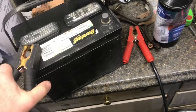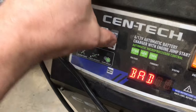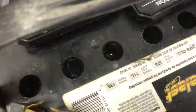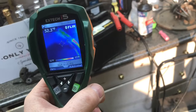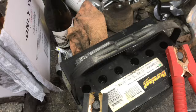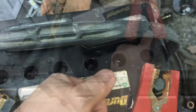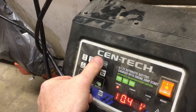Knowing that the battery's hydrated, I'll go ahead and keep charging it at 2 amps. Notice overnight the battery charger says it's bad. I'm going to cycle it to the 200-amp start — everything's got to be well ventilated. You can see the activity immediately in the cells. I'm going to do this for about a couple of minutes. You can see activity in everything except this last cell. The second to the last cell is not very active either. Look at the heat distribution through this thermal camera. I would recommend not doing this because the gases coming out are flammable. I'll stop the high power and go back to 2 amps.